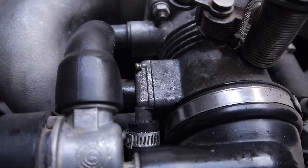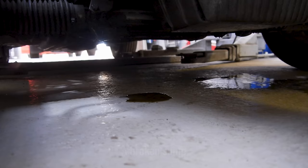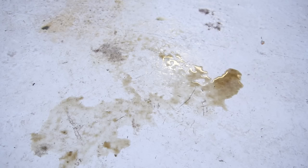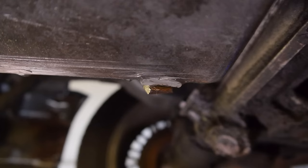It's idling at what sounds like normal RPMs and it isn't creeping up on its own anymore, so that issue is fixed. Once the second half of the exhaust is back on, I think this car will sound like its old self. The throttle body leak will need one of these gaskets to fix — they go for around £15 each, so not too bad. I've seen threads about deleting this part of the coolant system, but I'm just going to replace the gasket. The rest of the system is leak free and the water pump is creating good circulation. There's also one small issue at the bottom: the sump has been scraped along the ground, grinding down the bit around the sump plug, which is now leaking every time the oil gets warm.